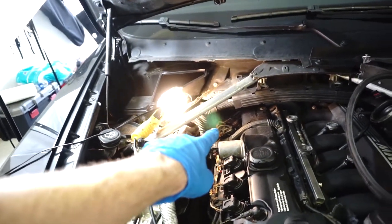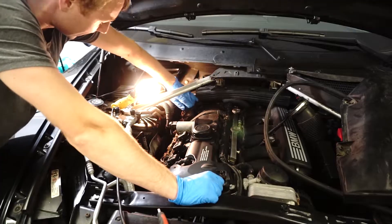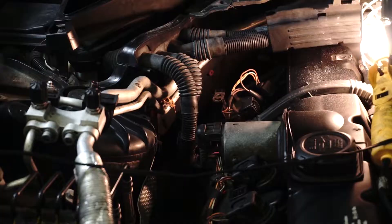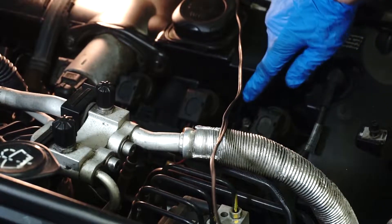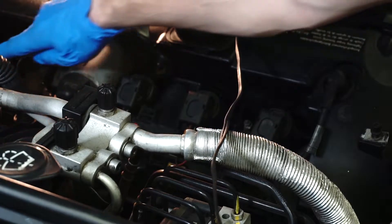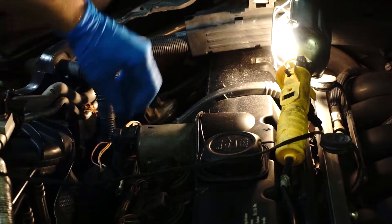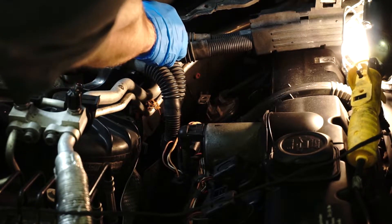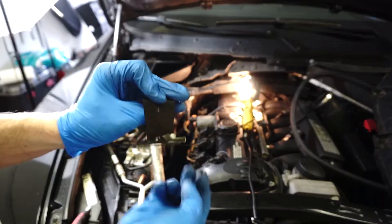Let's get into that spot and remove a couple of coils. To remove the coils you can stick your finger in there and pull them out. We're also going to snap one zip tie holding the wire tag, then remove the 8mm nut on the other side to release the tension of the wire. Take all these wires and fold them back. We need to remove the bracket here — it holds with a T30 at the bottom. Set up the T30 with an extension and we've got the bracket itself.